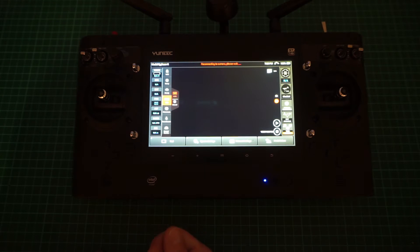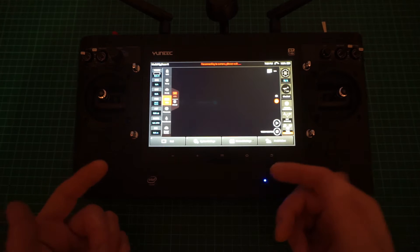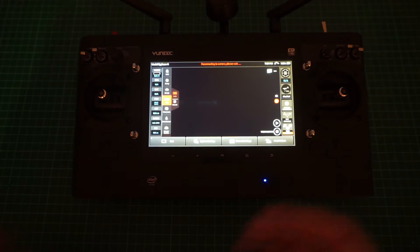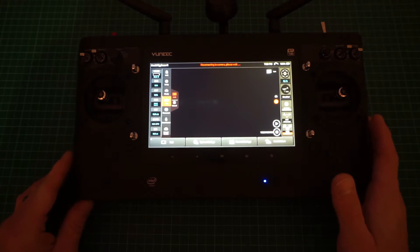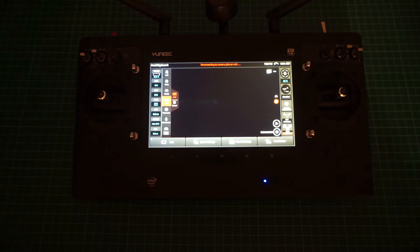Connect your laptop, go into the storage, copy all the files you can find — your pictures, your low resolution videos, your telemetry log files — everything the ST16 has on it. Paste them into a folder on your PC. That way you always have a backup, because when you reset it will wipe everything completely off the ST16.